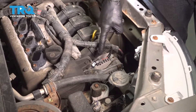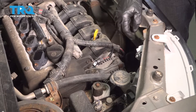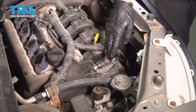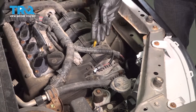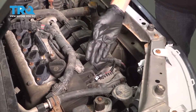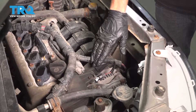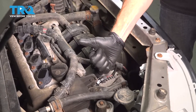Okay friends, the VVT solenoid is fully installed. As I stated at the beginning of the video, it's a good idea to go ahead and do an oil change on your vehicle — it only makes sense to have fresh clean oil in this area so you don't cause damage to your new VVT solenoid. After that, go ahead and start it up, make sure you don't hear any funny noises, you don't have a check engine light, and then take it for a road test. Thanks for watching.